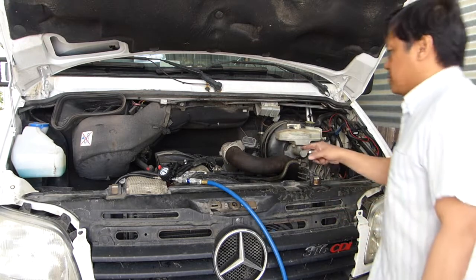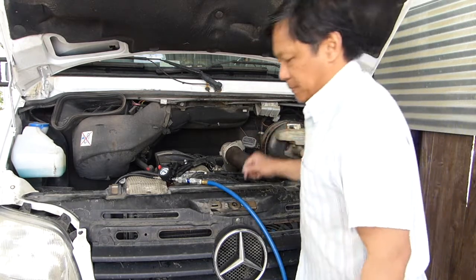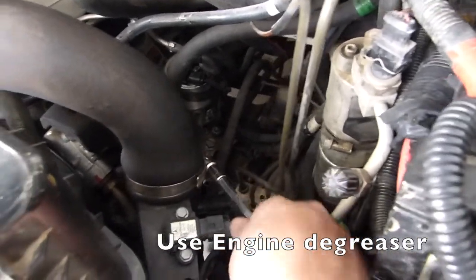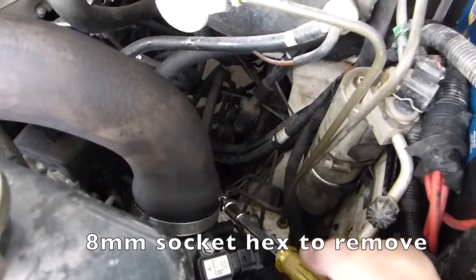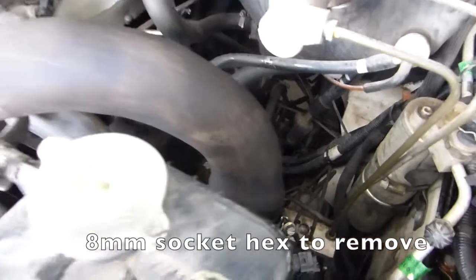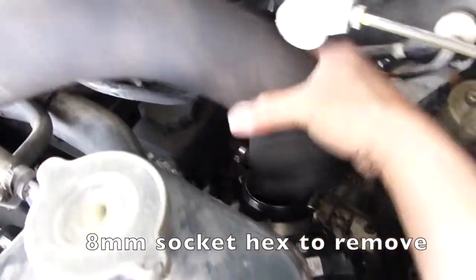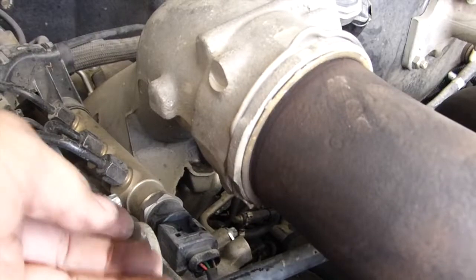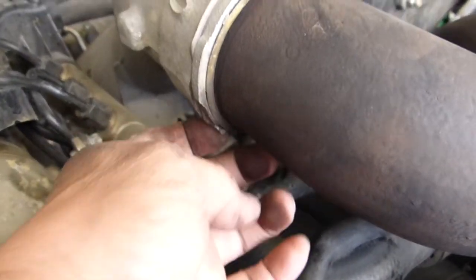So I'm going to remove this tube. It's an 8mm hose clamp — I'm going to loosen it. It's nice and clean because I used that engine cleaner to clean this out. Before it was all greasy with oil all over it. The hose clamp is nice and loose now and this should pop right off. It's completely off now. And then to take this off, you can see it's latched down here with that little notch — just need to pull that notch out.